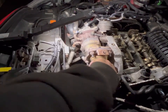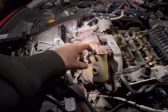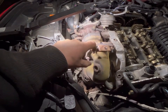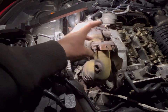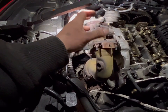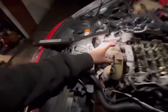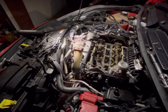There are 13mm nuts on there, and what happens is these have a tendency — no matter how much you try to avoid it — they'll catch against the actual thread and pull the threads through, which ends up pulling threads through the turbo itself. So you may end up having to use a tap and die thread chaser to clean them up, or get new nuts. We'll just see how successful we are.